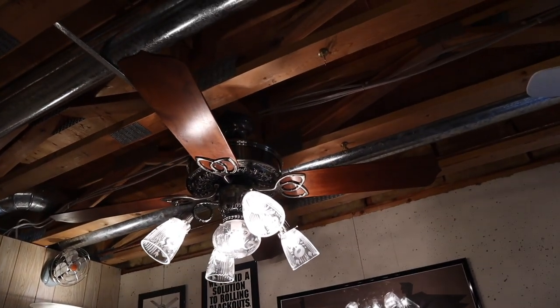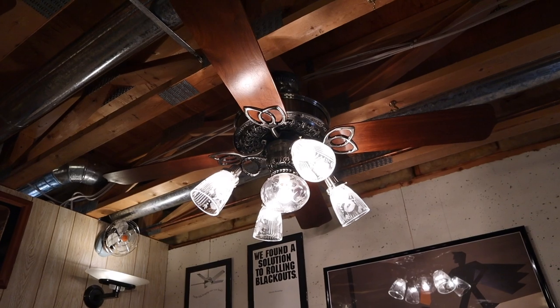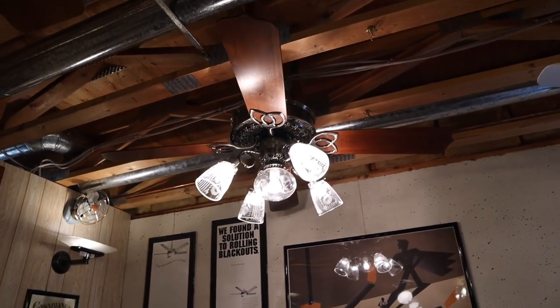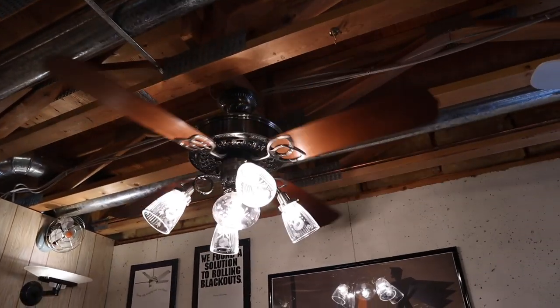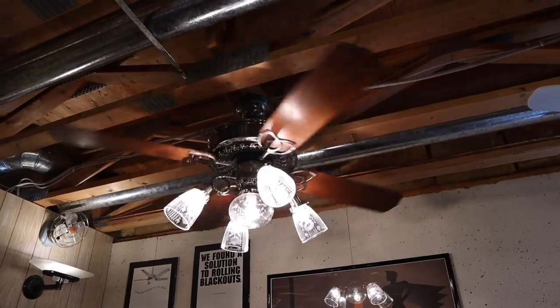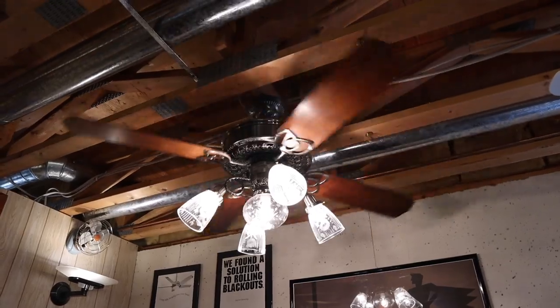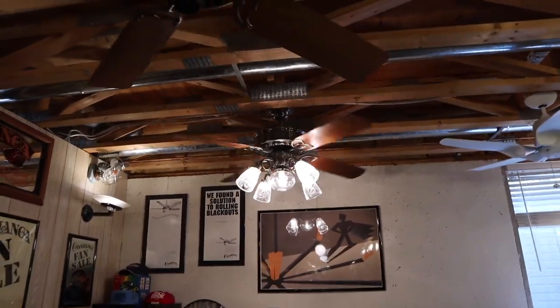I'm not sure how much disassembly and digging I'm going to have to do — I have to rewire the light kit in the switch housing and potentially take down the entire canopy to get that third wire at the ceiling. Everything is done and working now. It was definitely more in depth than I thought it would be going into it. I'd forgotten that the lead wires on this one were trimmed and re-spliced, and since the Slumber had been working I never tied in a new blue D1 option wire. I only realized this after I'd gone through the trouble of rewiring the light kit, so I ended up just taking off the downrod and re-splicing. Definitely was a bit of a pain, but I am happy with the end result. I didn't even think I'd get this part done today — I was really just looking to change out the Fasco.